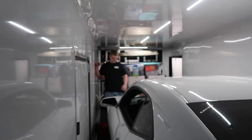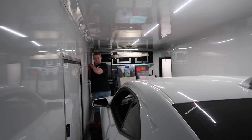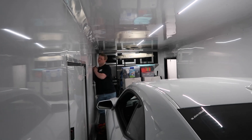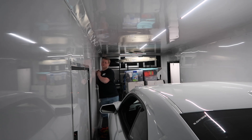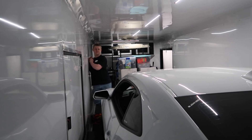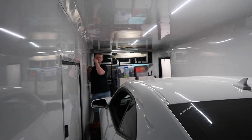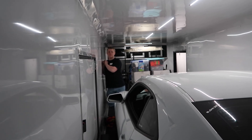We got the glide in her and one good axle. I'm going to make the call — it drove left, so I'm going to say the driver's side axle broke, and the passenger's side pushed it left. 50-50 shot. Inner or outer? Which hub broke? I'm going to go with the outer. The outer is just a weaker one. For the longest time it only broke inners — when I'd break them, they'd splatter everywhere. But because I didn't see anything, I'm going with the outer. Last time the outer broke it was just all bound up, and you said you might have heard that same clicking noise.